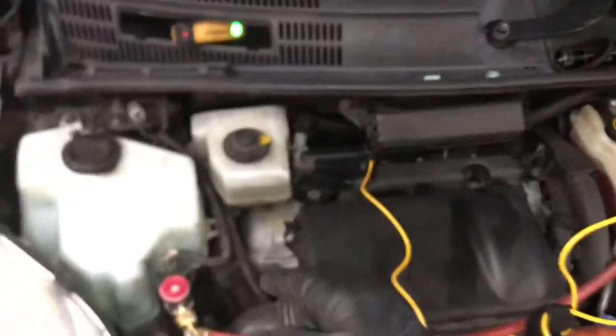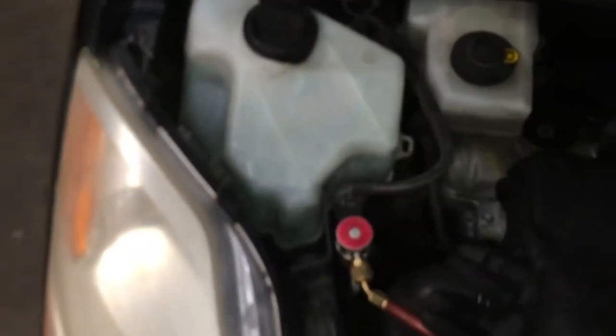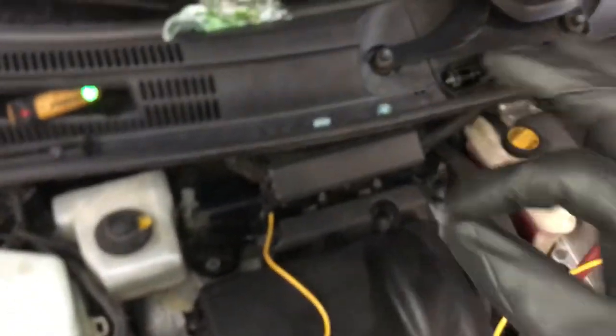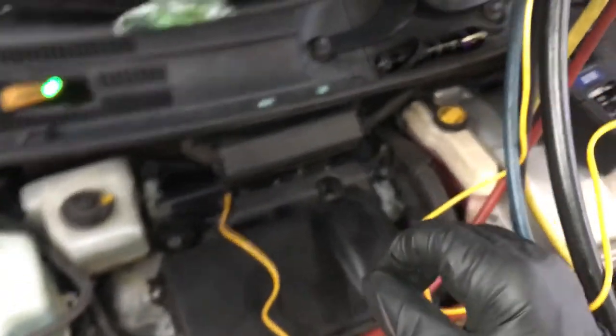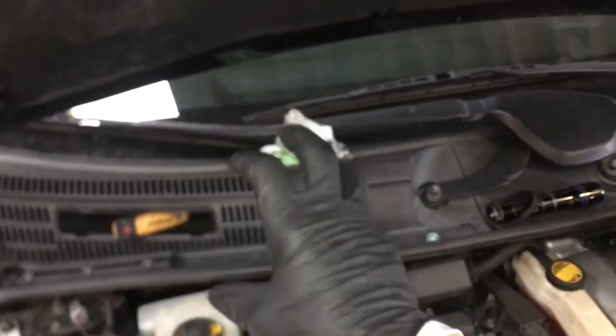The trinary switch here — the low side — is a piece of shit. It doesn't work. Not unless you were completely out of refrigerant below its cut-out point would it cut off your AC. There are guys on Prius Chat and other YouTube forums saying low pressure switches protect the system — that is not what I see. Those guys who say systems don't leak are wrong. Yes, they do all have leaks. They leak a little bit, some more than others, some develop a precise leak somewhere. But not all leaks are constant. Some leaks only happen when lines are vibrating, the evaporator is vibrating, the hoses are vibrating, the condensers are vibrating, the body of the car is flexing. The evaporator is going through expansions and contractions and vibrating in the case as you're going down the road — and it could only leak at that time.